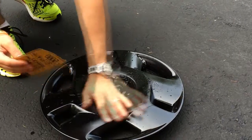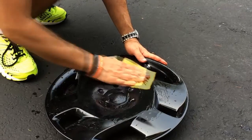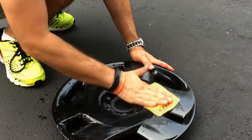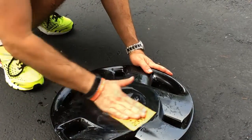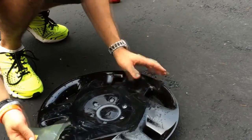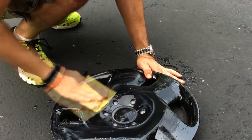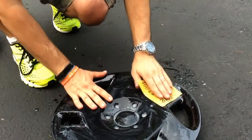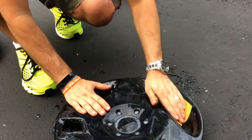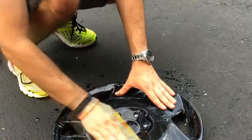Splash some water on and take the 2000 grit sandpaper — it must be 2000 grit. What you're doing is smoothing down the top surface because after it dries it's still very porous on top. You'll feel it change as you're rubbing, and the water will start to get a milky white color, which lets you know the top coat is actually sanding off. Do every nook and cranny, don't go too hard — pushing too hard will take all the paint off. One piece of sandpaper will probably be enough for a single hubcap. Wipe it off and switch to your polish.